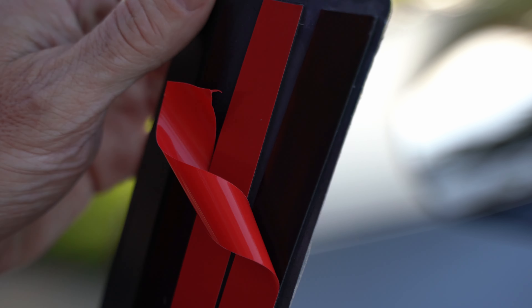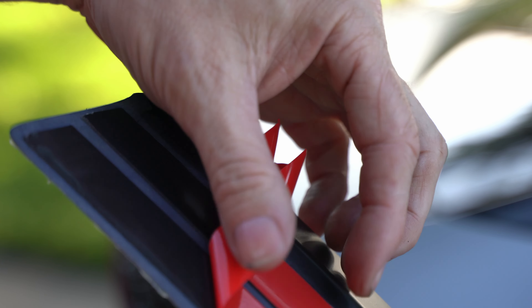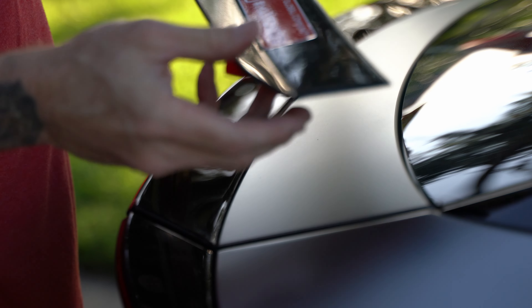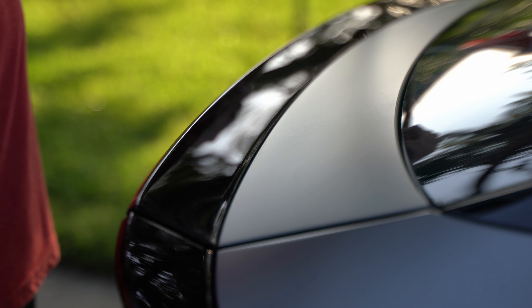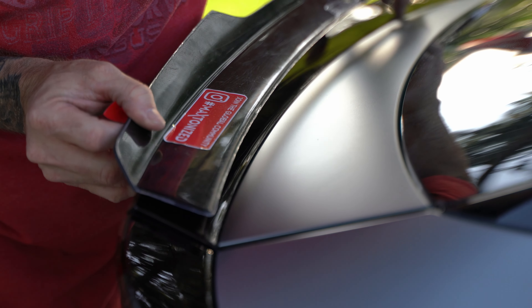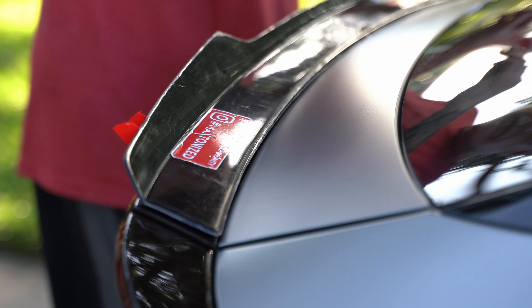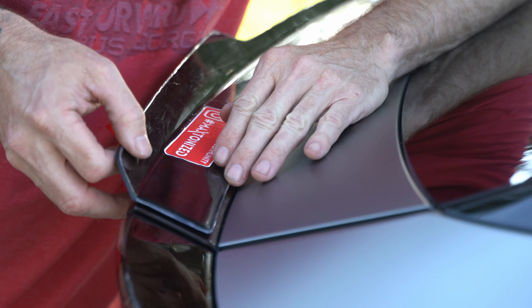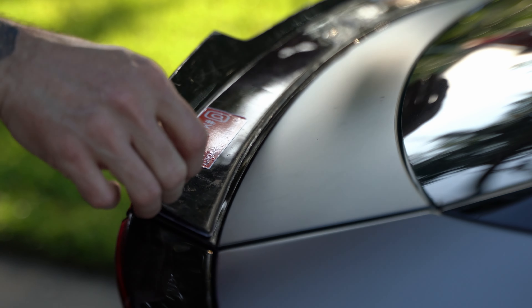My method for dealing with these stick-on lips and spoilers is to make little tails out of the red backing tape on both sides — just pull a couple of inches enough to hang out the back side of the spoiler. The reason I do that is so I can get an alignment and set it on top of where I want to put it. Only the very outside edges are sticky, which allows me to get it aligned perfectly before it sticks into place, because once you press it down it's not going anywhere.